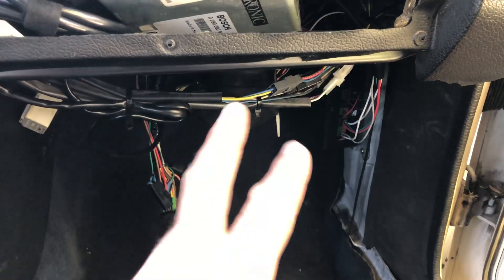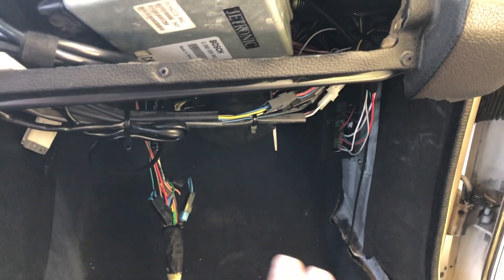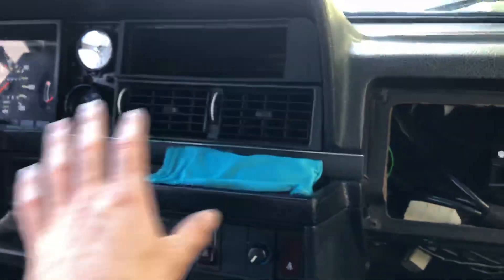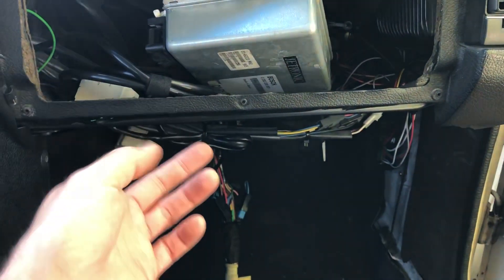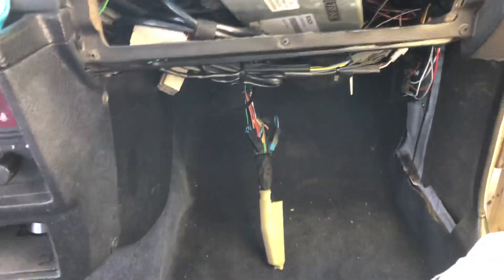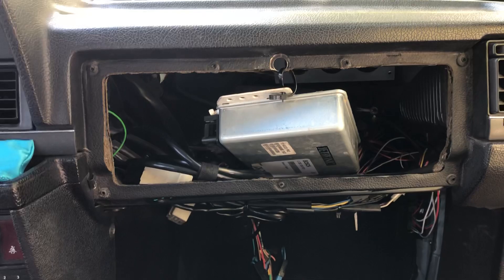The injectors needed two injector leads grounded by the ECU, and the LS coil ignition system needed its own wiring. However it was easy to pull power from the existing coil wire since the whole car uses relay systems that turn everything on independently. The ECU gives power to the injectors and coil through relays, so when you turn the key it gives the coils and injectors power. I didn't have to install new relays or a whole new power supply — that was the goal, to avoid the complexity of a fully standalone install.